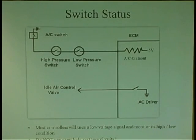You meant before when you could have sensors switched? No, what happens is a lot of times the O2 sensor connectors are very close to one another. And I've seen it on Mercedes, I've seen it also on BMW where the connector's so close, when the guys work on the motor, they go, where'd it go back? And they plug the sensors into the wrong place. So now you have cross-bank, where this guy's on this side, this guy's on this side, and he swapped them over. And your trims actually go opposite. So one side's totally negative 25, the other side's totally positive 25. That's how you nail it. Your trims go opposite each other. That's how you nail them.